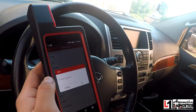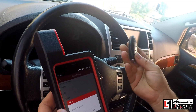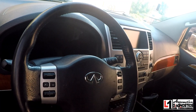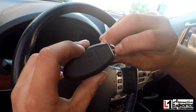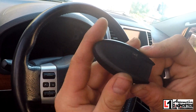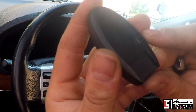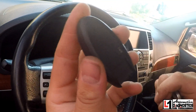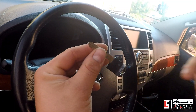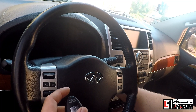It says switch on the ignition. I've got a key here that's not registered to the car. The mechanical key slides out the back — when you purchase these keys, make sure you purchase one that's the same manufacturer as the original equipment. This one is Continental. The key is already cut to the code from the original key tag, so we'll slide that into the slot on the inside lock cylinder.